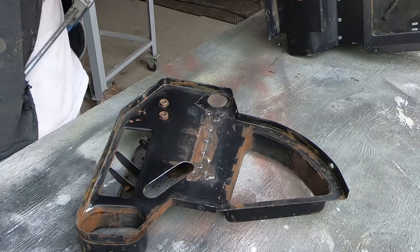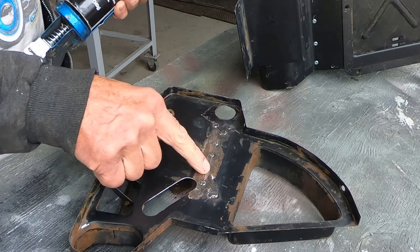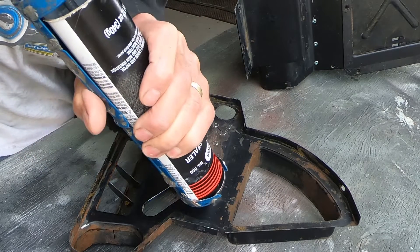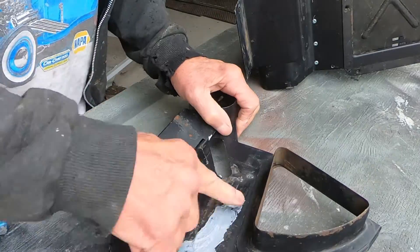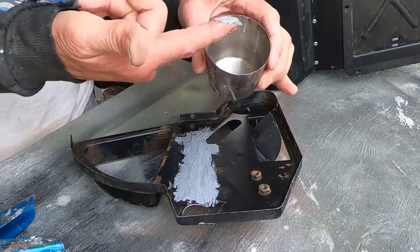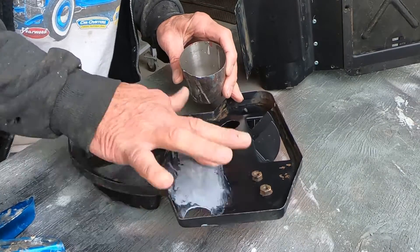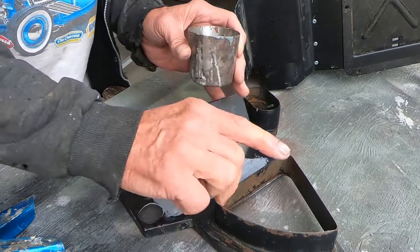Time to do a little cosmetic work now. I just got both of these pieces washed up real good. I put a few little spot welds where this little protrusion - or indention, whatever you want to call it - in this piece got cut and flattened out. So now I'm going to take some of this seam sealer - this is just regular automotive body seam sealer - and kind of put a little bit on here. I've got some lacquer thinner here to smooth it out a little bit. That'll be okay - it's going to get painted once it's back in the car. Nobody's ever going to see this anyway.